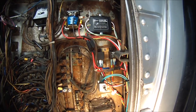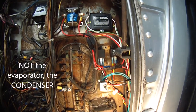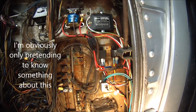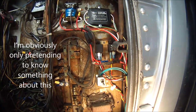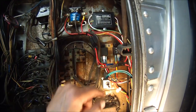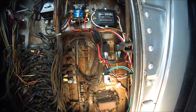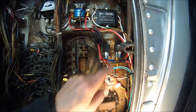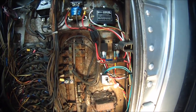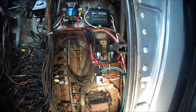I'll take a second to show you how I wired that up. The circuit is normally completed by turning on the switch in the front, and there are a couple of pressure switches in the evaporator that should shut the compressor off if pressure gets too high or too low. Obviously it didn't shut it off the last time — I think there was a blockage before the switch, or the thing overheated because there wasn't enough oil. So I added this relay, which takes the electric load off the switches and gives power to the compressor when the relay is closed, routing it through the relay rather than directly through the whole wiring system on the coach.